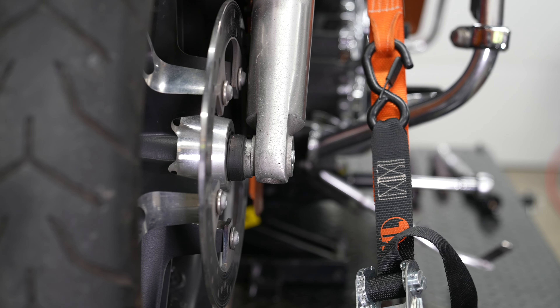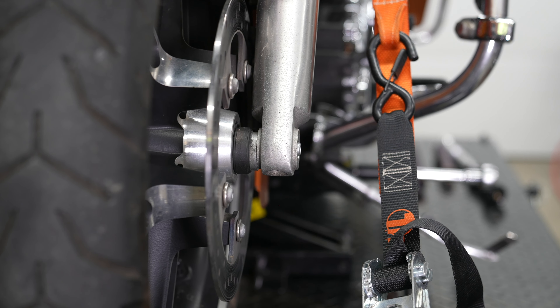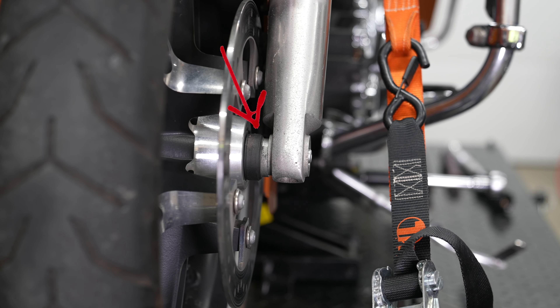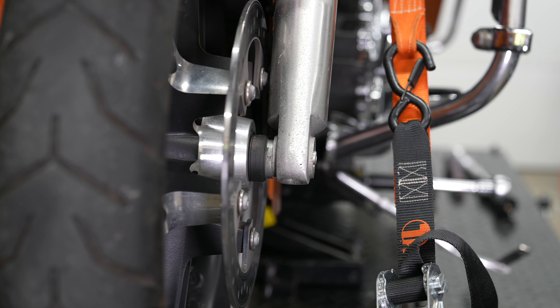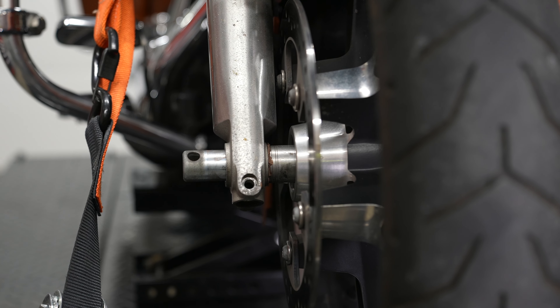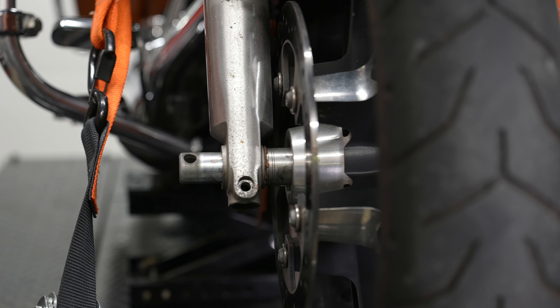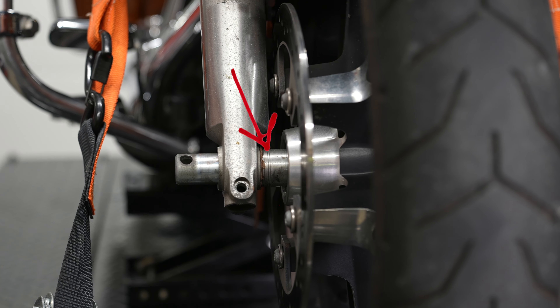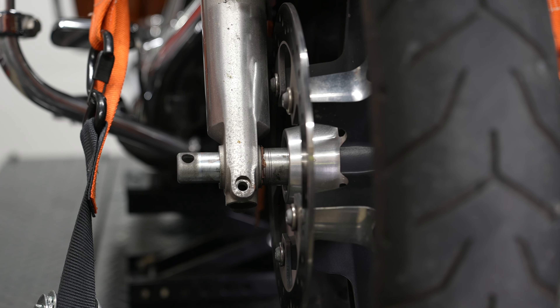On the left side of the bike, one thing to note before you start popping the axle through the rest of the way: you'll notice the black speed sensor with a wire on the backside — that is your ABS speed sensor. On the other side, note that between the forks and the wheel there is a spacer, and the machined grooved lines go to the outside. Note that because we'll put it back on the same way.